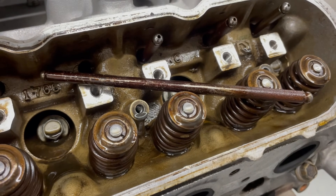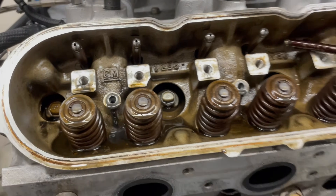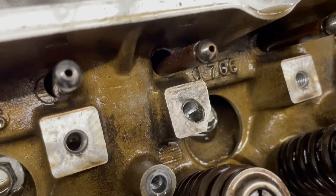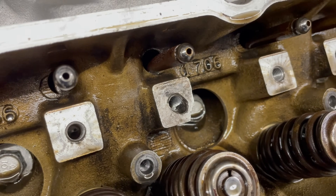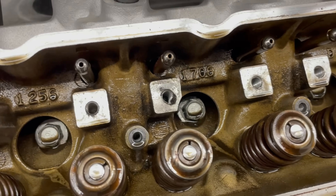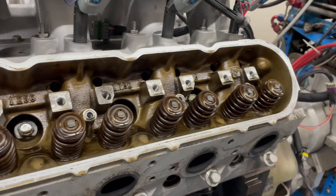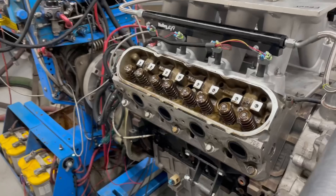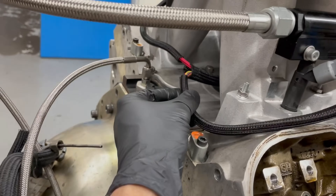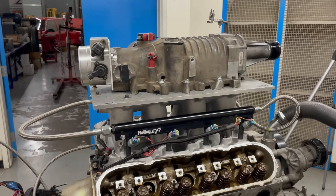Here we've got stock, rusty springs. Look at that push rod — does your push rod look better than that? I could hope so. Yeah, this thing's awful. Let's go around the other side and I'll show you how nice this thing really was. Take a look at this — the original guy, when I got this from the wrecking yard, tried to drill that out and missed terribly. That's the one where they tried to glue the rocker back in place — that didn't work out very well. We take out the rockers, push rods, and get each head prepped. We're going to leave our injectors connected, disconnect the main connector, undo all the bolts securing the high-ram, and lift this whole thing off as one unit.